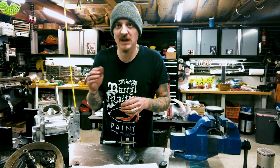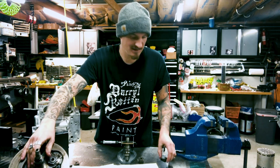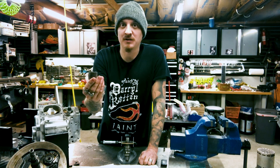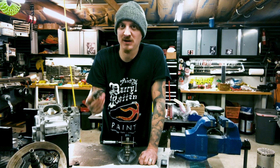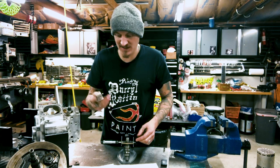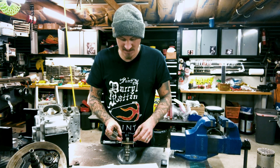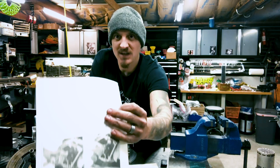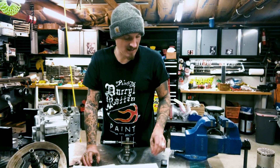Basically, cam gears — the sizes from manufacturability can vary slightly from cam gear to cam gear, and the same with the pinion gear that it meshes with. You can see this crank: the pinion shaft has a pinion gear on it that drives the cam gear. These can vary a little bit in size too, so they color code them with a paint dot to signify the size. You need to make sure you're running the right size for your cam gear. All you're using the pins for is to measure the pitch diameter of the cam gear effectively, and select the right color code of pinion gear. You just measure opposite teeth in the cam gear with a micrometer, look at that measurement, then look at the chart in every service manual — the page is falling out of my quality Shovelhead manual — and select the right color code of pinion gear. That's it, super simple.